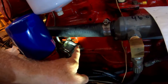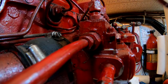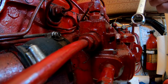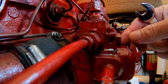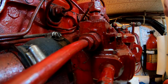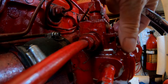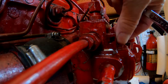I'll show you which one of these little valves you've got to bleed. I'm flicking the valve right now, and then right up here on the rail you'll see this little guy — you just break him loose. You'll see air coming out of there. It's just pure fuel running out, and you can see all the air bubbles coming out. Once those are done, tighten that up.